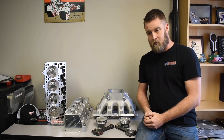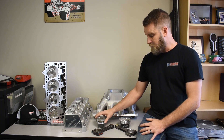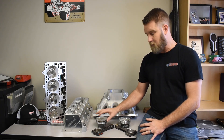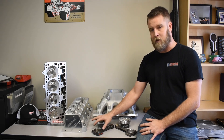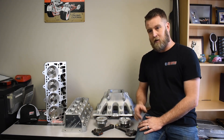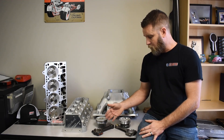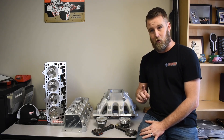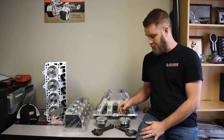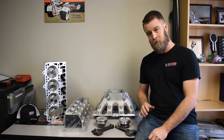You can use a Google search to find a bob weight calculator. We're going to have some nice still shot images of each individual component, both on the OE side and the aftermarket side, to show you the individual weights where you can figure the bob weights yourself. 1894 grams, calculating for four grams of oil on each setup, is where we ended up. It's been spot on the money.